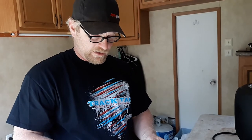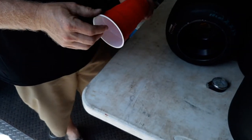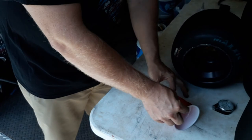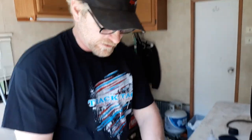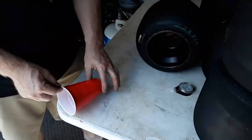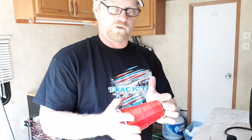Where stagger can hurt you depends on how banked the track is in the corners, and it can also hurt or help you down the straightaway. If you've got a huge amount of stagger — like this cup here — as you're going down the straight it's always trying to turn. That's what people talk about with scrub speed: you're losing speed down the straightaway because the kart is always trying to find the corner to whip you through. So you've got to know whether to run more or less stagger on the track you're racing.